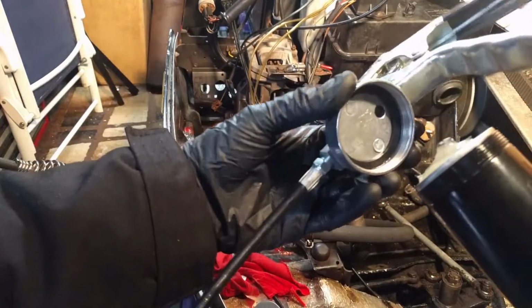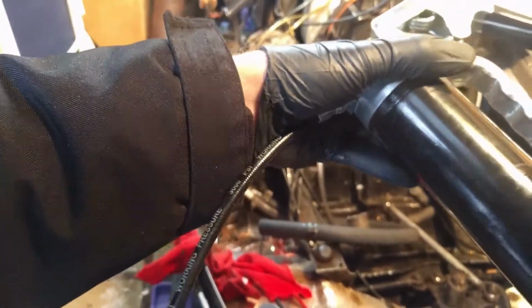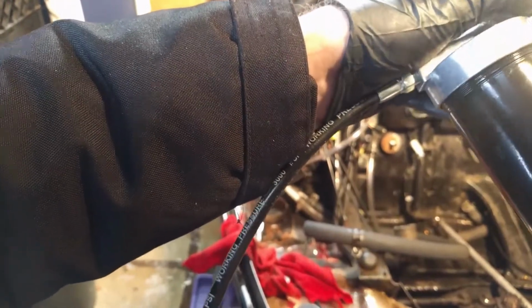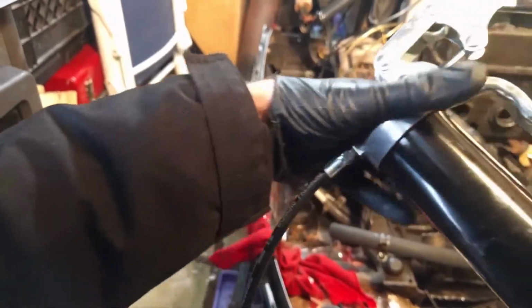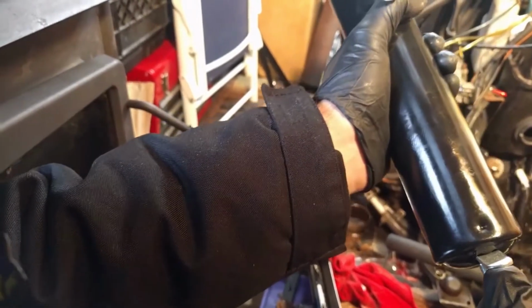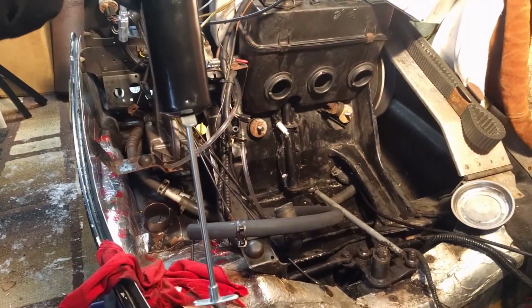Take your top, screw it back on. These threads are a little tricky, trying to make sure I don't cross thread it. There we go. Just had to get over that little metal can lip on the tube. Alright. So you've got it screwed on tight. Take your thumb, pull back a bit on the plunger while pushing slightly in on this. Don't just let it go, but slowly, as this is pushed in, allow the plunger to descend upward. It doesn't have a long way to go because you have your grease shoved in there, so that's what it'll look like when you start out brand new.